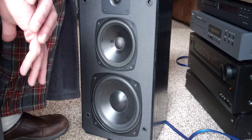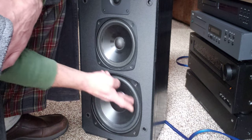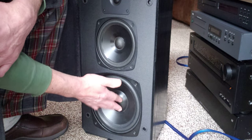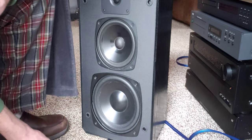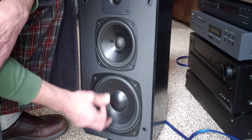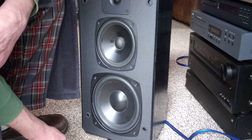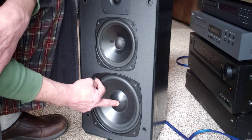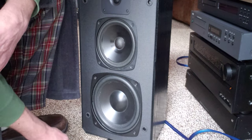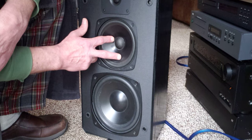It's hard enough to get these on there perfectly. Now, what this lower driver is here is a passive radiator. There's a sort of resonance it will give you. By being a passive radiator, that means there is no magnet on the back — it's just simply a radiator. It's like a regular woofer but they've stripped off the magnet and all the electronics, so there are no wires going to this whatsoever. This is strictly a sound reinforcement situation where it will just radiate the bass that's already inside the cabinet, generated by your actual woofer.